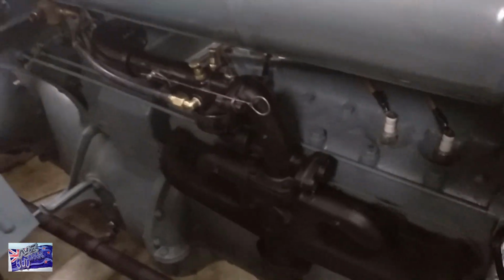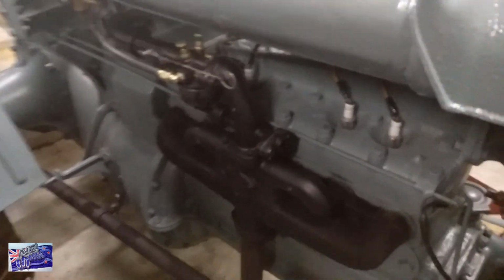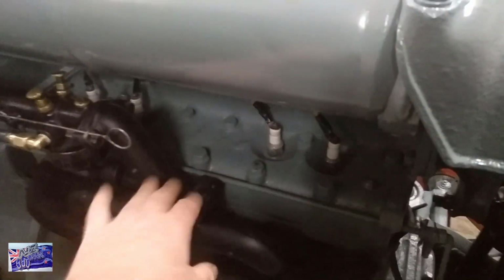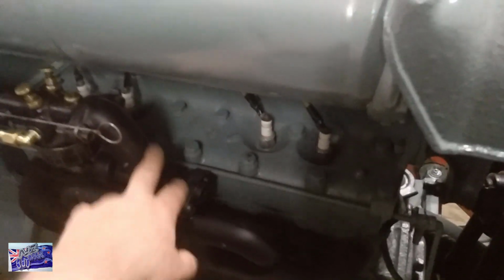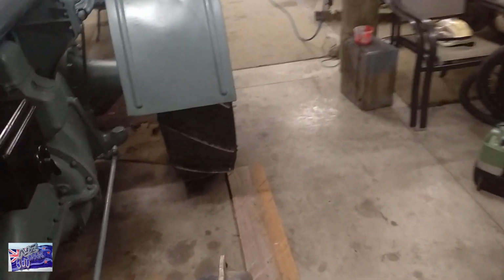The carburetors are very old, strange things. They've probably done a lot of work over the years, and we've got them running as good as we can. They work pretty good, but with the poor design, when this is running, it gets really ice cold. So it's not ideal. You want a little bit of warmth in it, but with the fuel running through it, it gets pretty ice cold.